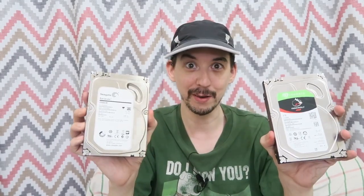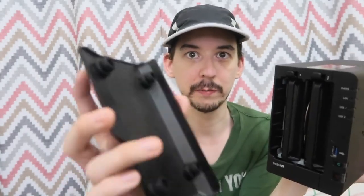I've gone off on a tangent about hard drives, so let me explain the NAS itself. The cover has rubber bumpers to help with vibrations from the drives. On the front there's a USB port — but this isn't where you connect it to your computer. This isn't like an external drive that you connect via USB. It connects to your router via an Ethernet jack — one gigabit — on the back, plus two more USB ports and an eSATA port.